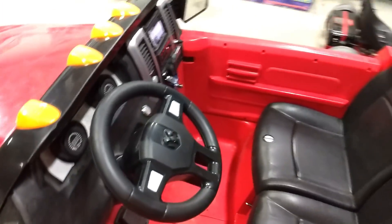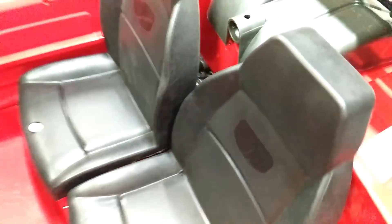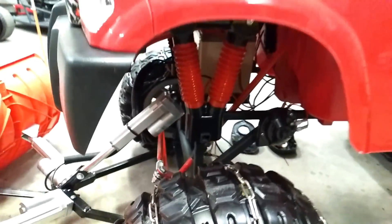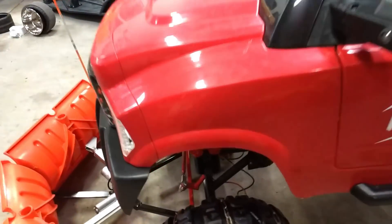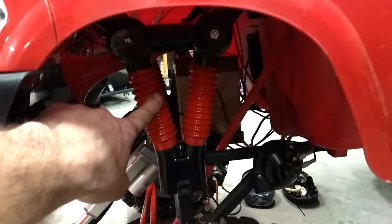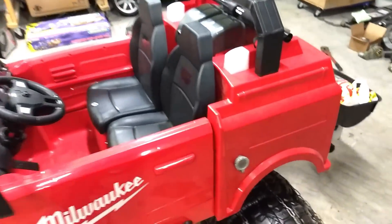This is 24 volts. We've got one battery under here — it's a 26 amp hour 12-volt Gruber battery from a mobility cart. We installed the other battery in the front directly over the front axle for better traction, and we also needed room for that giant battery. We also painted the shock towers — gloss red and gloss black.